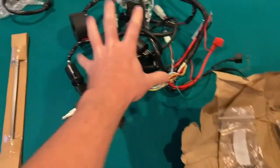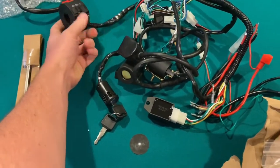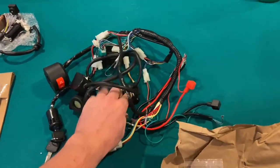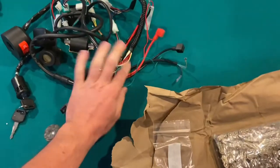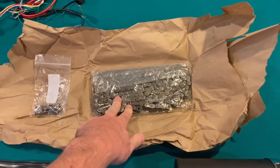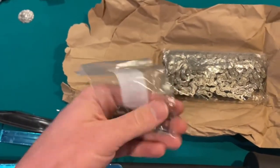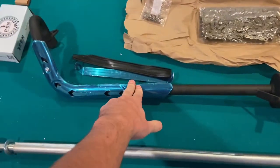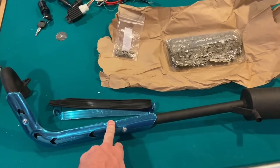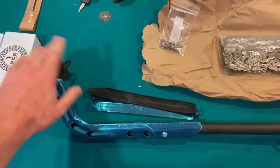This is a quarter-inch by quarter-inch keyway to fit in the slots for the sprocket and the brake. This is the wiring harness for the motor, which includes the key switch, the electric start, and headlights. We also have a rectifier for additional lights, a spark plug boot, and starter wire. Then we have 6 feet of 420 chain — I bought more than I probably need, plus some extra master links just in case. You're going to need an exhaust; I got this one for about $50 on Amazon. I could have made my own, but for $50 I'll just see if this fits.